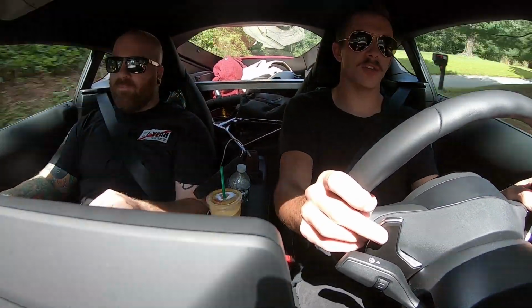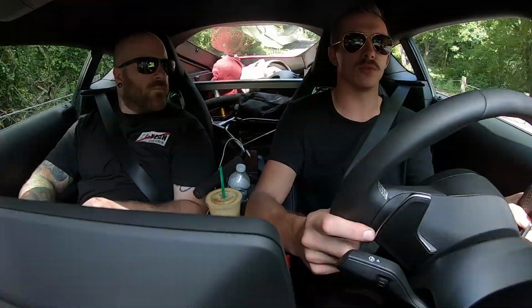Interesting. Yeah. I know that Toyota is planning on coming out with different models. There might be a 4-cylinder one, there might be a turbo one. But I know one thing that me and Jordan even spent a lot of time on. The way the gas pedal works on this, a certain percentage commands a certain load. And now that the car's making more power, 10% throttle instead of commanding, let's say 100 foot-pounds of torque, is commanding 200 foot-pounds of torque.